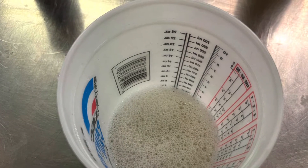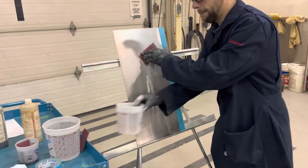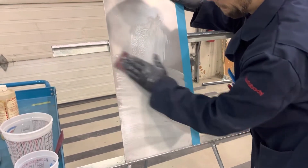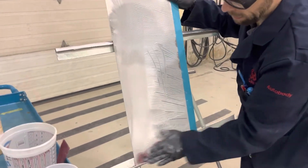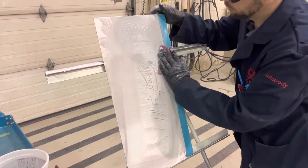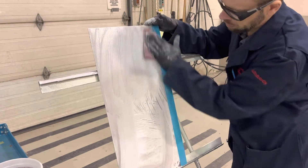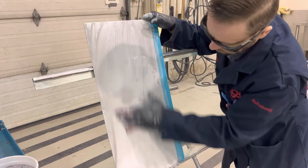This is what the product looks like once mixed — it's reduced with water and applied to the panel. Once applied, you'll see it foam up as it reacts with the aluminum — that's the acid. Use a scuff pad and apply the product in all directions, scuffing very thoroughly. This product will bite into the panel and remove oxides. You'll see dark gray showing up in your pad and draining off the panel. If doing a large area, start from the bottom and work your way up to prevent the material from dripping and etching into areas not yet scuffed.